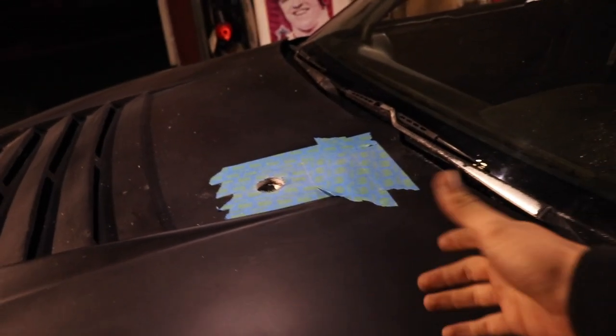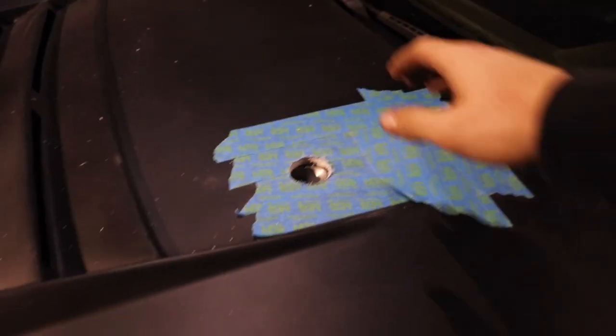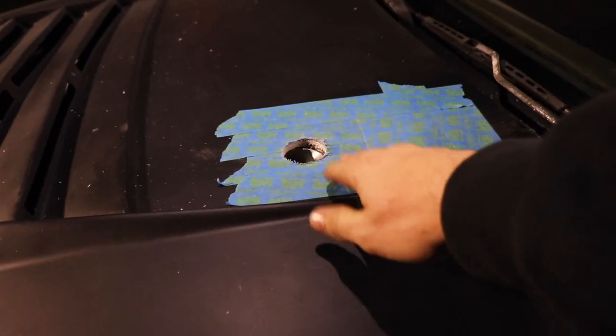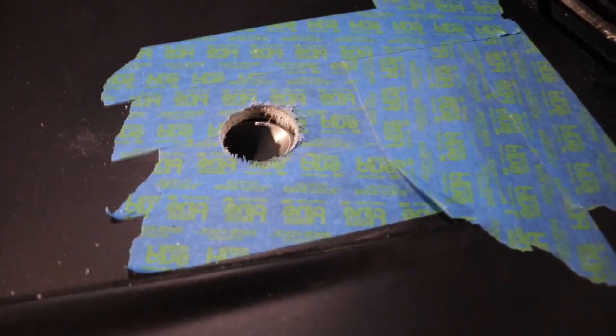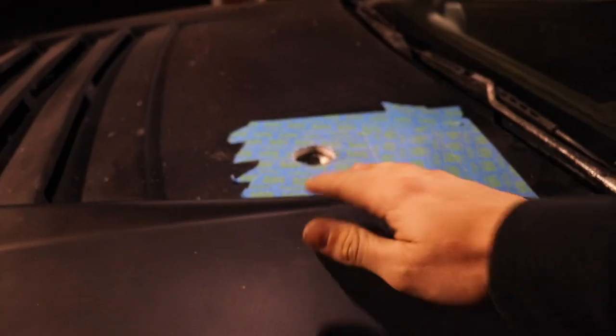So you saw we cut the hole — I was very nervous about doing that, but it came out really good. Now we just have to file our way backwards. I'm hoping it doesn't poke out too much; I measured it to where it should poke out just barely. It is holding the hood up a decent amount and we do have some thickness there in the hood, so it might be exactly how I want it. Essentially I want it to where if you look from here, you don't see it at all — in line with how the vent has that line that goes back.